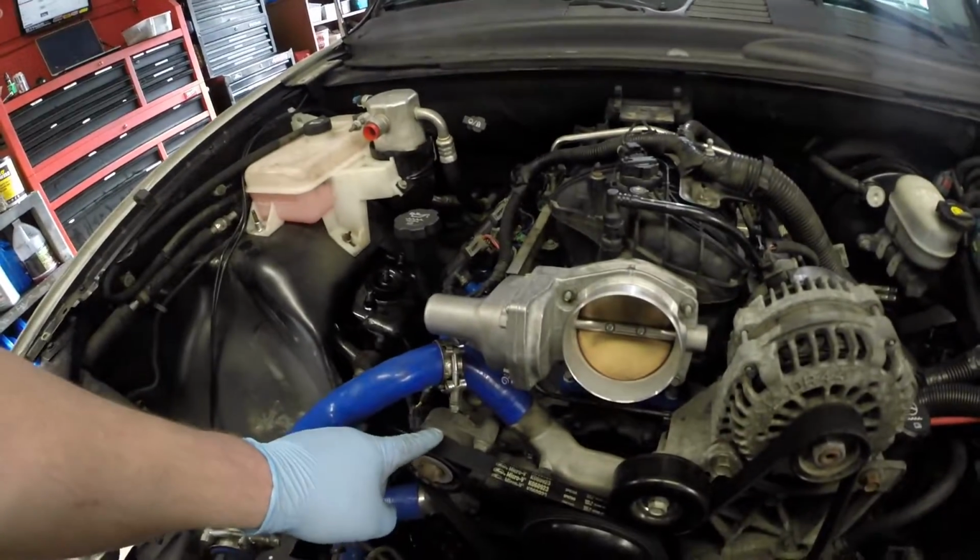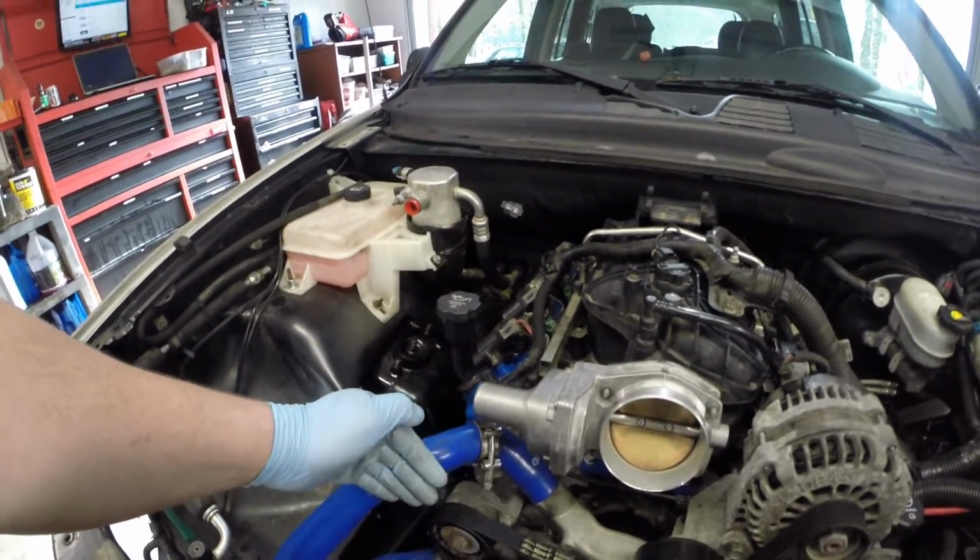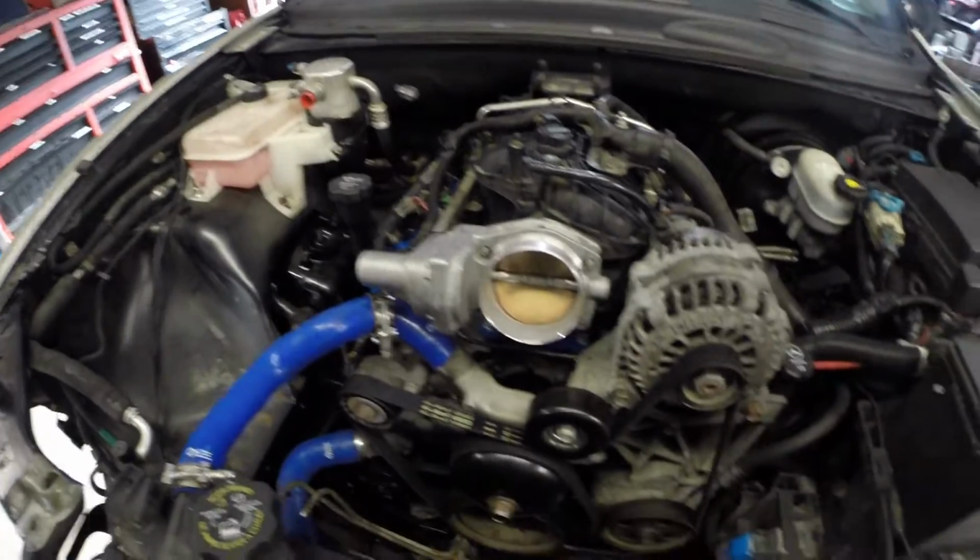On the trucks, when you do the LS1 water pump upgrade, basically you're just going to get the water pump from an F-body and the tensioner, because the stock tensioner doesn't fit that pump unless you modify it. So that's pretty much it. You get the spacer kit, the water pump, and the tensioner. The same belt fits, and all you have to do is find the radiator hose to fit.